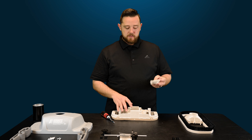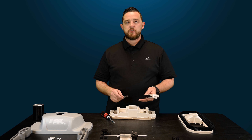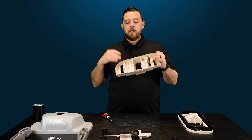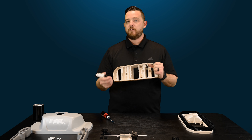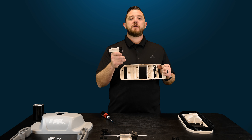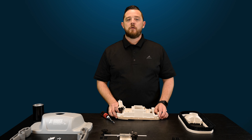So it does have special molding in there, making this its own specific item. You guys can purchase the spring separately if you need a new spring, or you can purchase the brush — of course we've got both available for you guys on the website, so make sure you guys check out those links in the description as well. So essentially, it is important that you guys make sure that this is maintained. These bristles are going to fall off over time, especially depending on the surface of the pool, the usage, chemical composition, all of the above. So you want to make sure that these bristles are good so the cleaner has that extra edge to lift up and get over debris without causing issues.